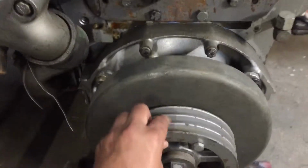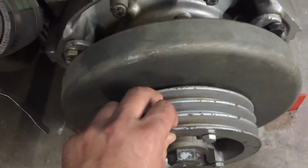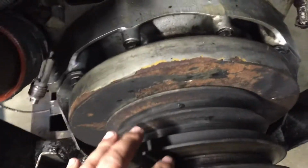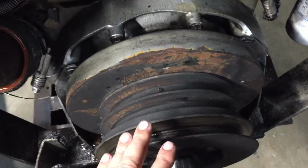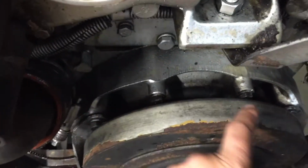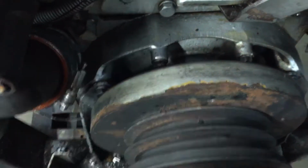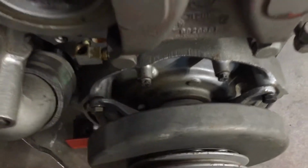In addition, you see these pulleys. This is for, I don't know, A or B drive belts. They're small grooves, and I have C-sized pulleys. These are huge grooves because I have the biggest belts you can buy to run my blower fans. Also, you notice there's a tiny little space back here between this harmonic balancer and these bolts, okay? Very little space. So this is shoved right up against the engine because there's not much room in a bus. There's a huge amount of space here. So I'm gonna have to switch that.